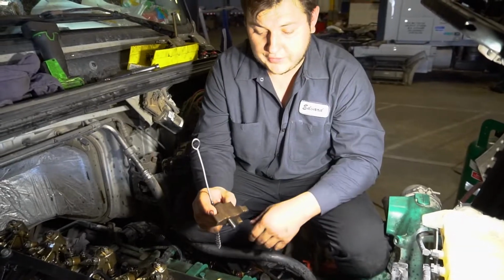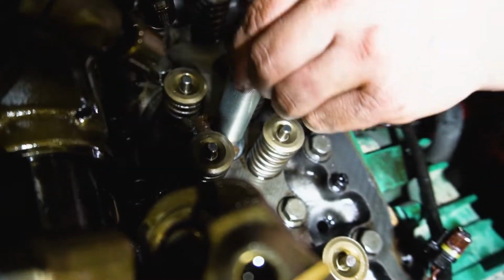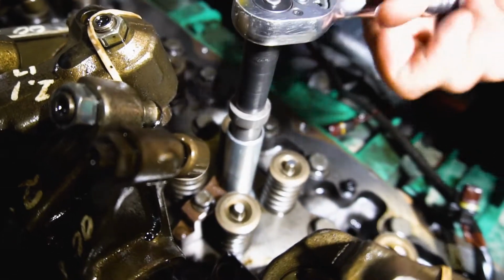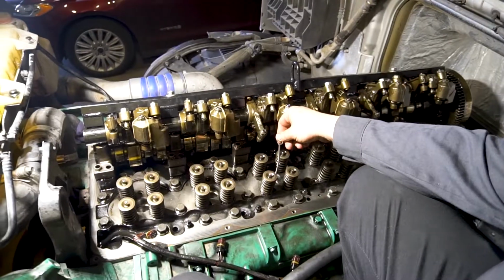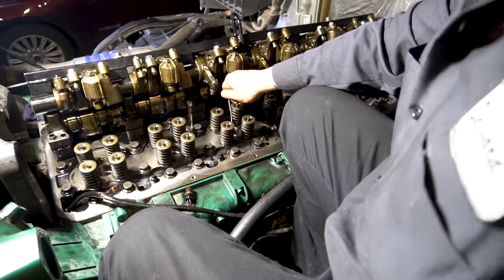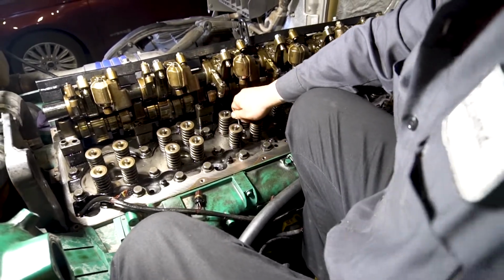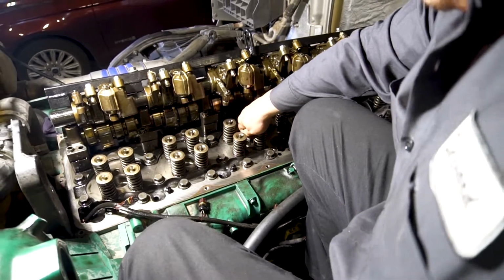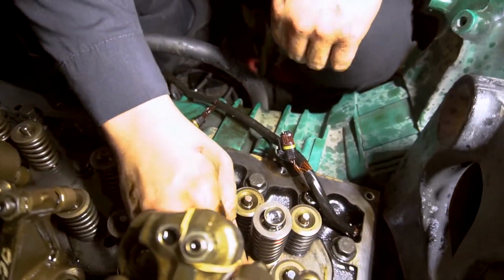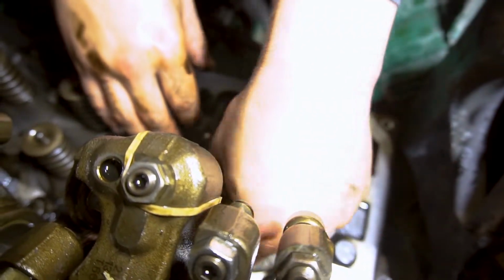You grab an injector, hold down, lift this, all the way, and then you push it in. That's it. And this is how you rotate this engine to have your engine cylinder sit down. Spin it by the alternator, and you put it down. The engine goes down, and it's all the way. And this is how you install the injector. Place it in here. Make sure it's straight right here, and pop it. See, it popped. And you kind of twist that bolt.